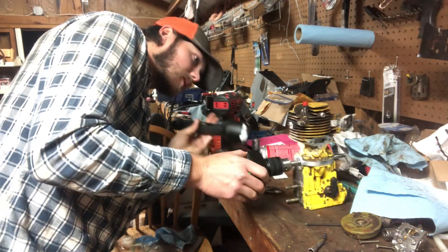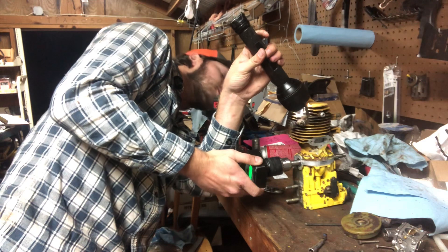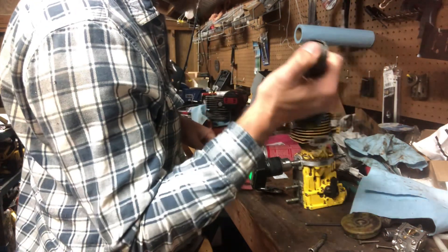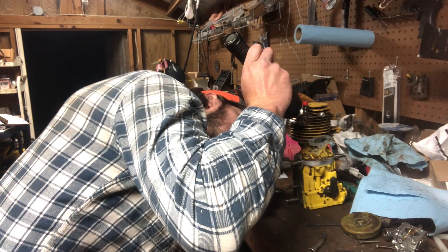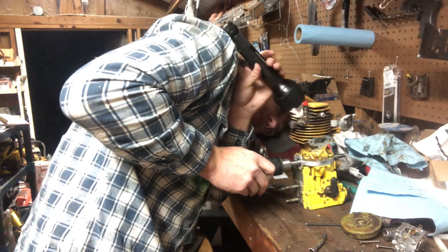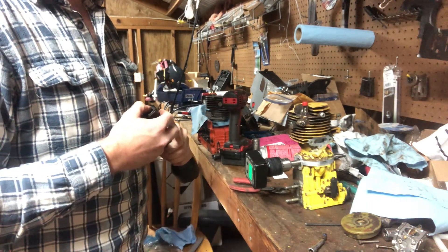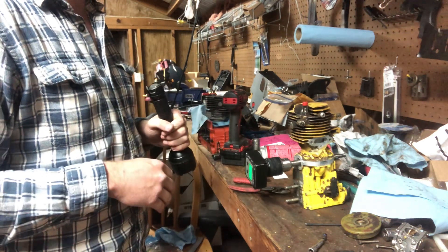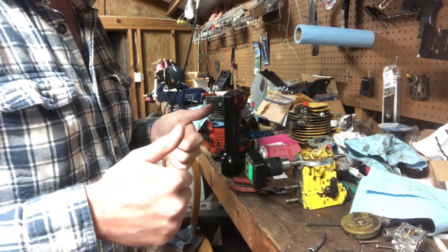See as it opens back up, she first cracks right there — about 66, 67. So that should put us at 120, 134, 135 — somewhere in there. Should be pretty stout. When our exhaust opens — it opens — got to get some of this out of my way. That my flashlight's about shot. About 100, just about 100. Didn't really touch the exhaust at all, just widened it, took out that little narrow section. Literally just widened the port, opened the port up, and angled the port.